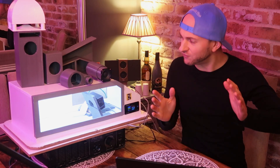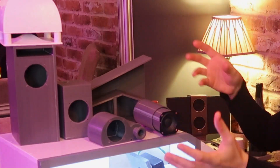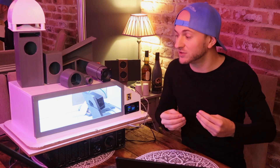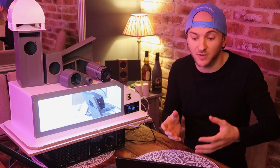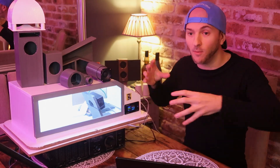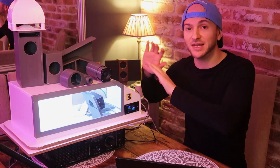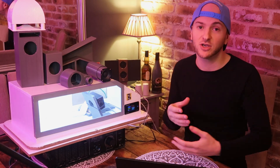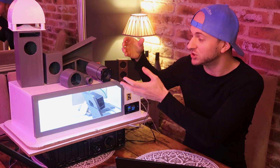The bottom three of the door closed category are all very, very close - like 0.1, 0.05 of a dB off each other. My explanation for this is that most of these enclosures have been tuned pretty low, so their port emphasis and dB boost are at the lower frequencies. With the 45 and 60 scaled hertz, they're not really being influenced much by the ports. So they're all very similar output levels anyway - we're just listening to the radiation from the cone of the driver rather than any Helmholtz or port or quarter wave boost. Those higher frequencies are all going to be about the same, and this cabin will boost and emphasize lower frequencies if they are produced potently by the enclosures themselves.